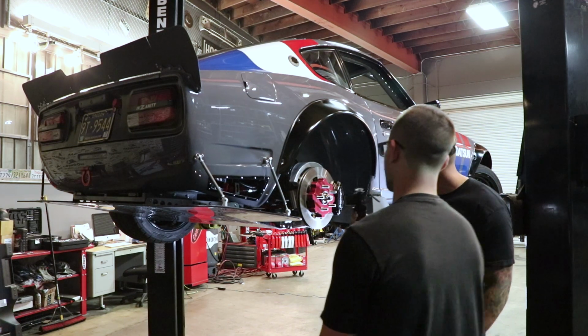And then what about this whole rear diff mount setup? Because this all looks like it's made out of some form of billet. It's all billet. That again is Arizona Z car, but it utilizes an Infiniti Q45 rear differential. Oh, wow, okay. And then Nissan Armada CV shafts actually. I like how it's got the provisions for the sway bar to bolt to, pop off and run through there. Super cool. The differential cooler system is modified into that cover, so we're shooting cooled gear oil right on the ring gear to get splash distributed. Oh, no way. Yeah, you can see the pump is up here. Those electronic Tilton pumps are kind of heavy, so I wanted it low and central as I could.